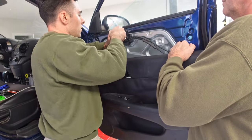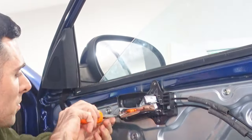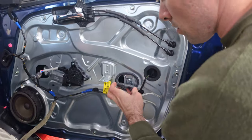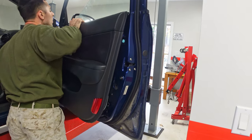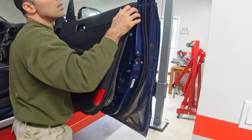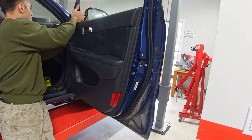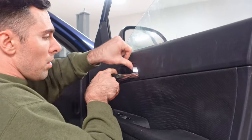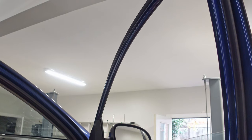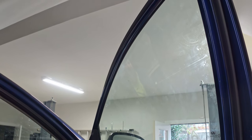Make sure you test the window before moving on by turning the car's power on and running it all the way up and all the way down, making sure it moves easily without any issues, closes properly in all areas, and doesn't stick out when it's supposed to be down. If your window works without any issue, go ahead and reinstall all your remaining parts. I hope you find this video informative and helpful. Make sure to click that subscribe button and give me a thumbs up — we'll see you next time on the DIY Grunt.